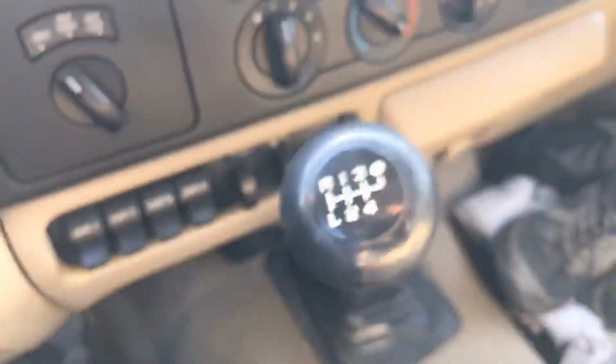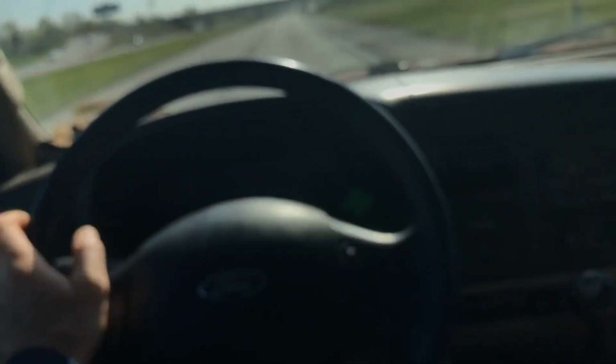I just noticed that these manuals, when the engines get a little, this is 150,000 miles. I mean, it's not a worn engine. Not horribly bad, but I do notice when they're up to par, and maybe when that number six injector gets replaced, it should pull itself, not in granny. It should take off in first a lot better than it does once we get that number six injector. And that's where right now the high idle of the SCT is actually helping us, because the idle's a little higher when you go to let out, and it's not going to bog it as much.